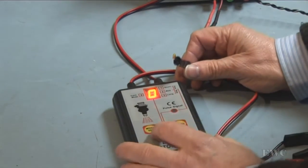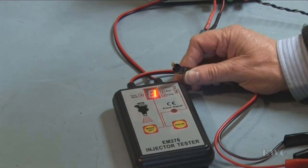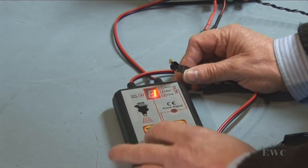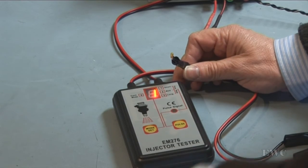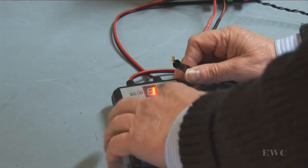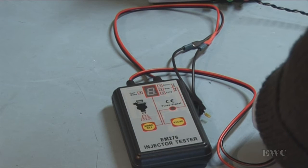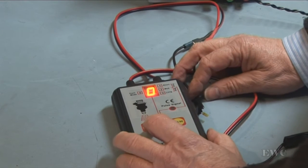First of all, we go to mode 1, and that is one pulse. It just outputs one pulse and the pulse width is 250 milliseconds — very short period. There you go, it's a quick flash. One thing I find a bit annoying is you can't change the modes while it's connected up. You have to power it down and power it back up again. Go to mode 2.